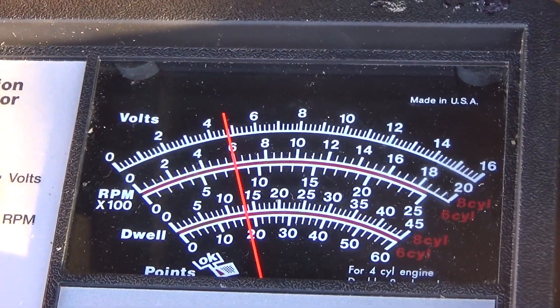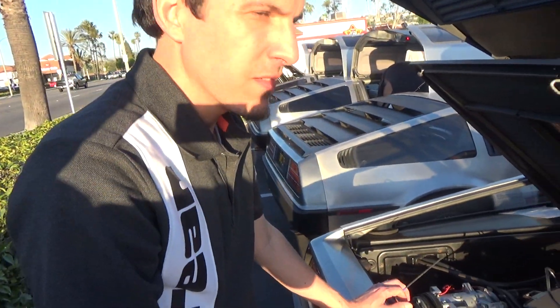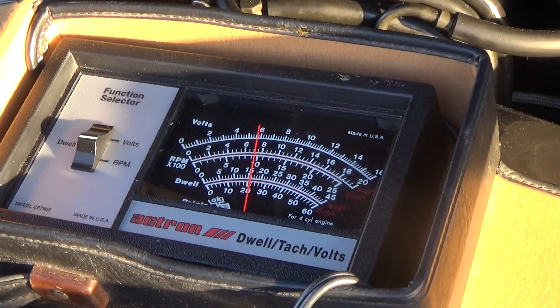I would drive the car and then go back and re-read it and see if it's holding. The benefit of making sure your mixture is in the correct range is for optimum gas mileage and to make sure you're not burning too much or too little fuel. The primitive computer in the DeLorean is trying to optimize the mixture, and if the mechanical adjustment is off in any one direction, the computer tries to compensate to richen or lean out the mixture. As long as you have the mechanical adjustment set, the computer will be able to maintain this 15 to 20 swing on the dwell, and you should be able to maintain an optimal air-fuel mixture ratio and shouldn't smell a lot of unburnt fuel coming out of the exhaust.